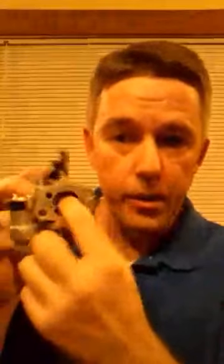It's big up front. Then it's got that small area in the middle, and then it's big in the back again. When that air goes into the carburetor, it goes through that small hole and it speeds up as it goes through it. That's what creates the vacuum to pull the fuel up through the E-tube or either out of the low-speed jet. And the bigger you go with your venturi, especially with these, the more work you have to do on the air bleeds and all to make them work right. But that's another video for another day.